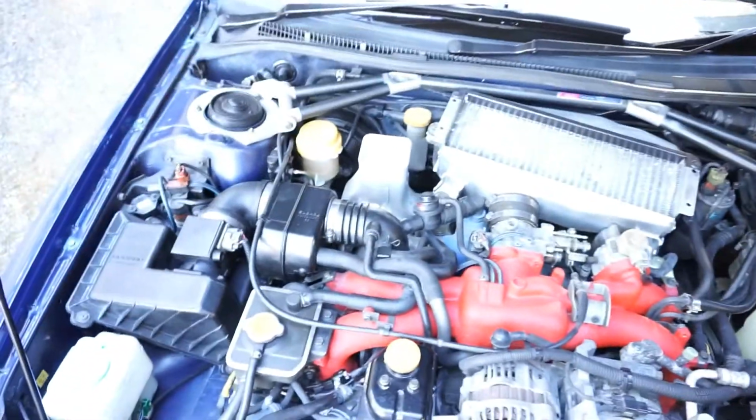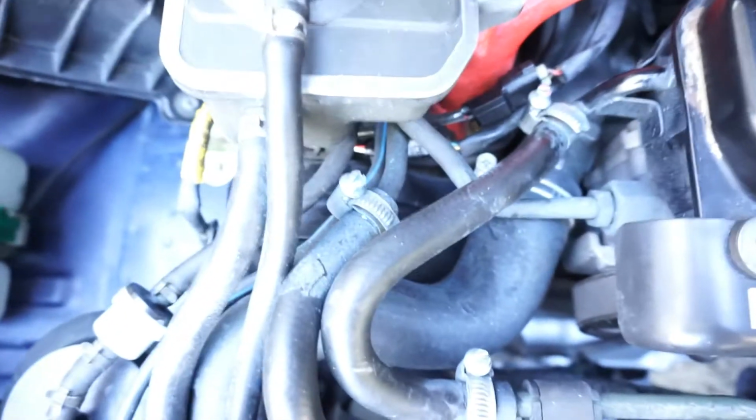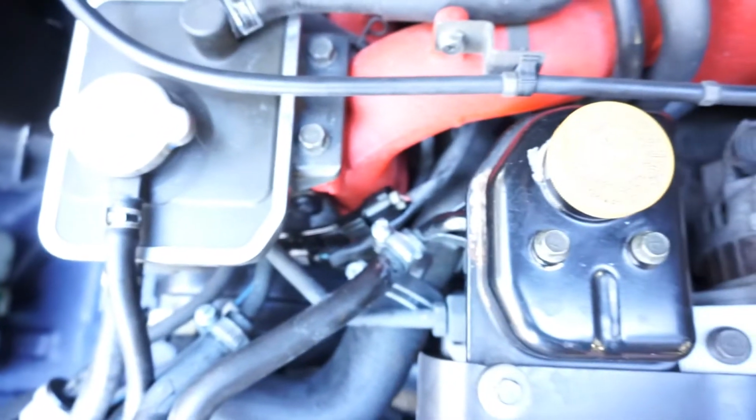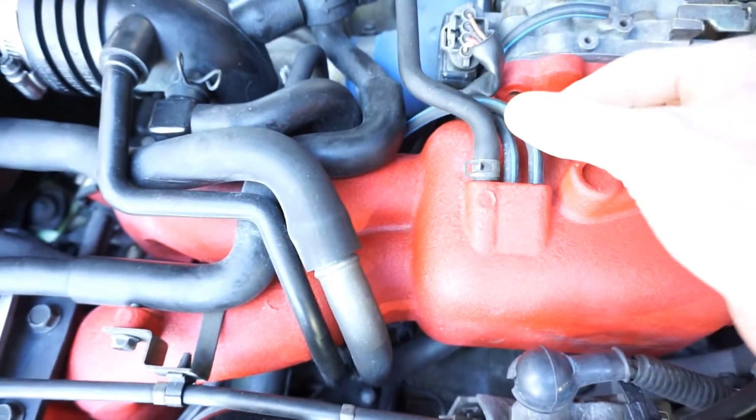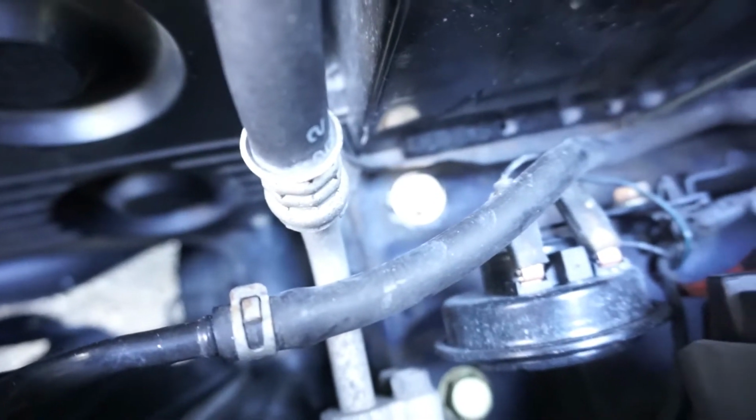Pretty cool stuff. Other than that, during my restoration, I replaced all the hose clamps, the majority of the hoses, refurbished the IC spray tank, and really gave everything a good clean. This was refinished because you can't buy them anymore. The accessory belt cover. All the vacuum hoses are replaced because they get brittle and hard after a long time. And a couple other trick little things. A lot of the bolts I took out were re-zinc coated, yellow zinc.